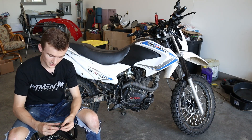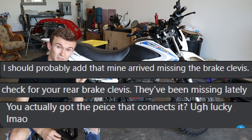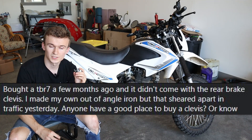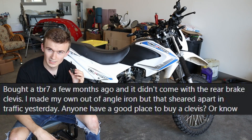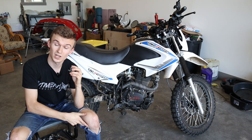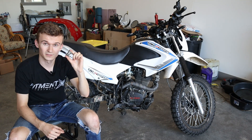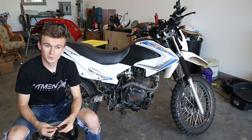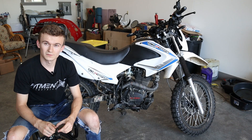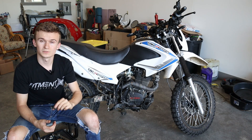Mine's a 2021 model. Whether your clevis never came — which happens for about 50% of TBR7 buyers — or your clevis broke while riding, which I've seen in a couple of small cases, or the stock pin that holds the clevis to the rear brake lever shears off while riding, which happened to me and is why I'm no longer using this clevis — if you're a TBR7 owner and encountered any of these scenarios, you've probably looked around for a replacement clevis or even asked your dealer and found that there are none.